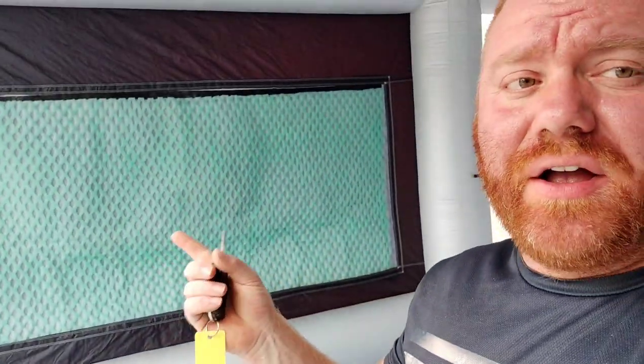You guys saw my last inflatable paint booth. I was using a 2-horsepower blower and a suction duct on one of the filter vents, and it's still, you know, there was a lot of overspray in there. The larger the filter outlet area for your booth, the easier it's going to breathe. It's just like putting on a bigger intake on our performance car, right? The bigger the intake, the more air the motor can breathe. These really massive outlet booth filters is really what sells me on it.